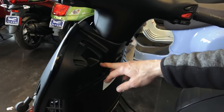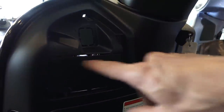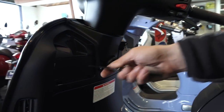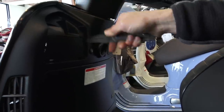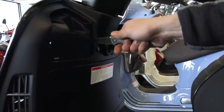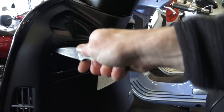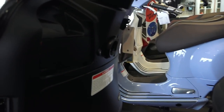And if you look at this new 2019 bike, I think starting in 2017, they put a block off plate so you can't get access to the turn signal flasher. Real simple to remove. There's, I think, 6 tabs. And just take a knife and cut the tabs, and you'll be able to fold this out. And obviously you don't see this. The only function this serves is some type of anti-theft, so you can't hotwire the bike, I guess. You know, it's pretty silly. I've never seen any theft attempts where they tried to pull that off. Maybe in some countries it's an issue.